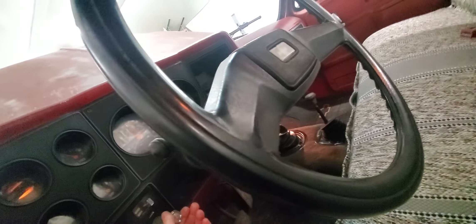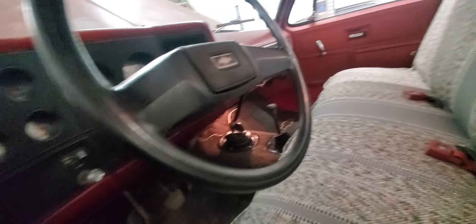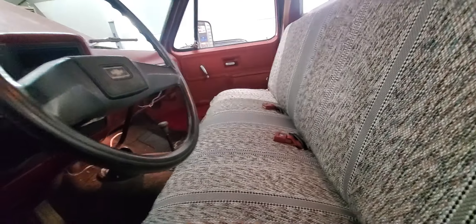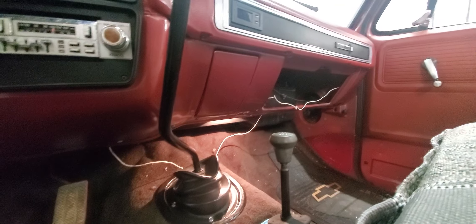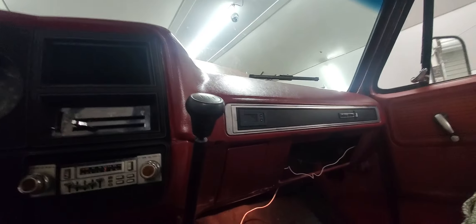The under-dash light, everything works off the knob for the headlights. Open the door on either side and the pin switch turns on and off — you can see it, all the lights work. I don't know for the love of God why somebody took that all apart and jerry-rigged it. Just a little meter and about an hour and a half, two hours of looking through the wiring — I didn't even go to the book for this one. Being a wireman, wiring is my thing, I wanted to get this one on my own. I was pretty happy with it.